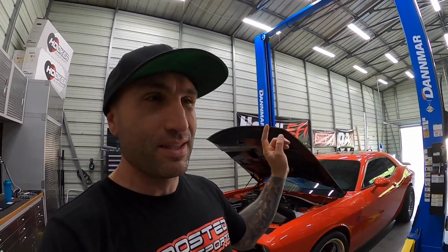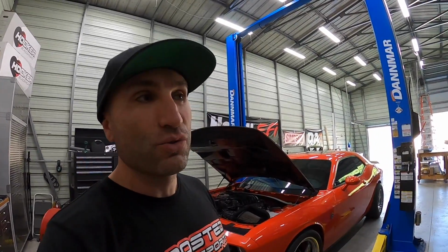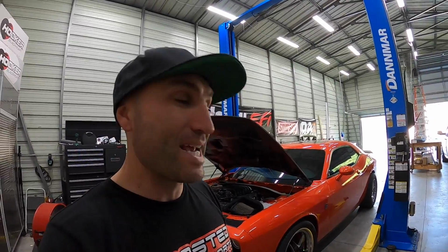That's probably going to get sent out to get redone, because I think there's some sort of warranty on it. I got to talk with my buddy on it, but either way, we can always put the stock rear pumpkin back in. Of course, it's more work, but at least we can still enjoy it while that one gets sent out and comes back, because that's so loud that I'm almost a little nervous to even put it around like we were, because that thing is almost grinding in there. I bet you if we drop that rear differential fluid, it's gonna look nasty.